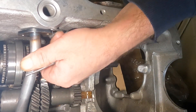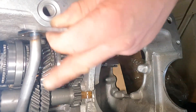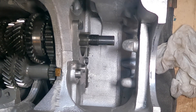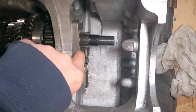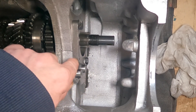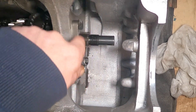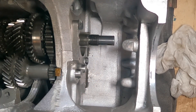So basically all I've got to do now, I'll turn the gearbox round and start doing stuff up from the other side. We lost a little bit of footage there — basically what it was, I was just fitting the bearing retainer. The battery went flat on the GoPro and I didn't realise. So basically all it was, was just putting the bearing retainer on, doing the three bolts up to torque, and then just flattening over the lock tabs. So we'll just carry on with the next job.